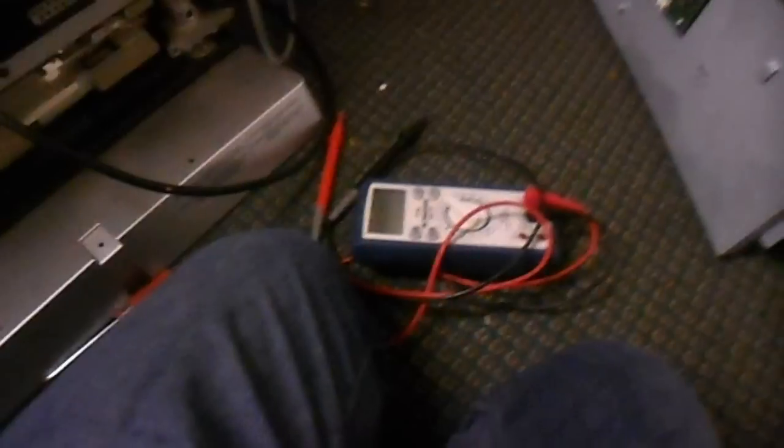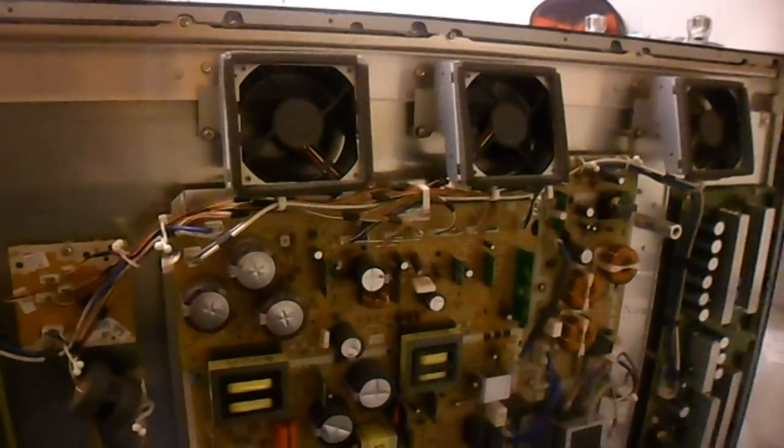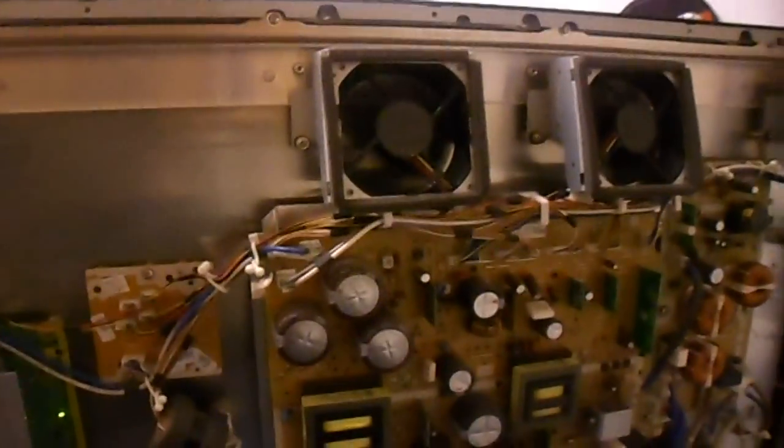But it might just be because my meter is plus or minus 0.7% or plus or minus 1% or something like that. Any inaccuracy, I mean, you're thinking about that's at least 2 volts that could be out on a 200 volt supply, so it can make a difference to VSUS because it's suggested to adjust it within 1 volt. So I'll leave it as is because it appears to be working. Those pots don't tend to drift.